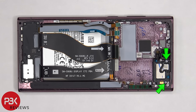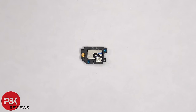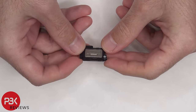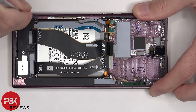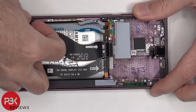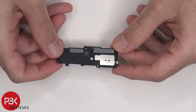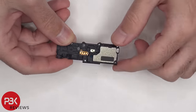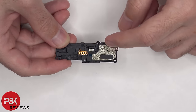There are two Phillips screws holding down the top speaker assembly that need to be removed. This top speaker assembly has little white foam balls on the bottom and top corner. The bottom speaker assembly can now be removed. There's a thermal pad on the bottom as well as the little white foam balls. The linear vibrator motor is located on the bottom speaker assembly, behind the speaker.